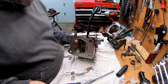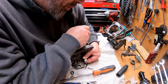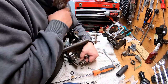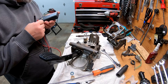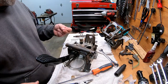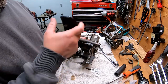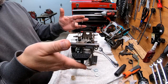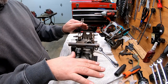Now we're going to run the brake light switch in until it actuates. You want it close to be a hair trigger — 14 millimeter. This is where I could use four hands. Let's test the brake light switch. My meter's dead — after 10 years the 9-volt battery in my multimeter took a dump on me, so I'm going to have to test the switch functionality later. But I have no doubts just by the way I can see it actuating that it's going to work just fine.